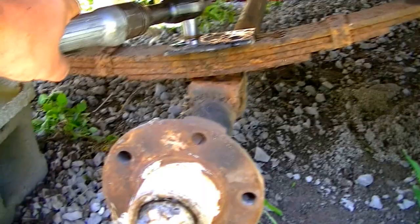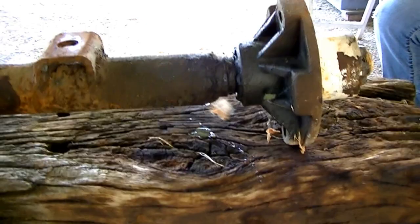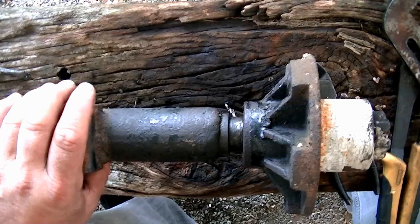We're going to have to take it completely off the trailer. We got our axle off and we've made this little frame machine here. First thing we're going to do is clean it and inspect it from one end to the other — make sure there are no cracks that need to be welded up from when it was bent. This side here is the side that's bent, and most likely it's bent right under where the U-bolts fasten to it. You can see how much the axle's bent when I rotate it, especially if you look right here.